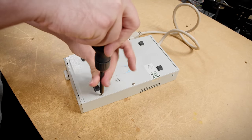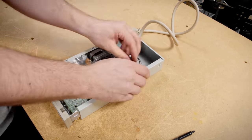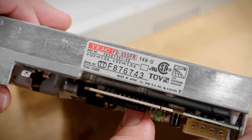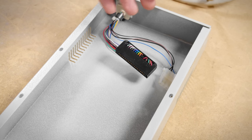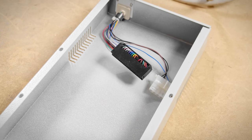The drive inside is a typical PC drive with nothing special going on, so if I open it up I could absolutely just remove the drive and put it in something else. The drive in this unit is a pretty handy TEAC FD55GFR which is good for reading 1.2 meg and 360k disks. But it feels like kind of a waste to leave this perfectly good external enclosure.